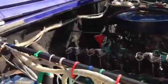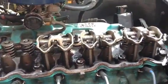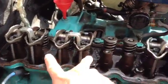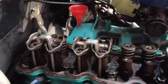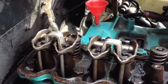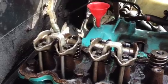I'm back — the cleaning is done. I've mounted my rockers, but I'm still waiting for push rods for cylinders five and six. I decided to take them out of cylinder four and put them there temporarily. I need to run the engine now because with all of these products it's better that they get evaporated or burned off as quickly as possible. The valves seem to be moving freely now, not yet like the other valves, but already a lot better.